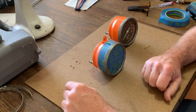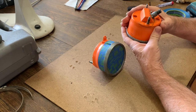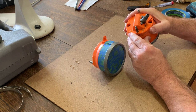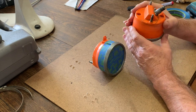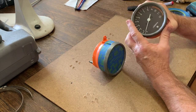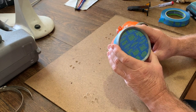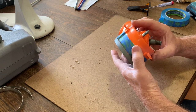Part of the restoration of the instruments is restoring these parts — the tacho and speedo. This one had a crack and the thread head stripped on this pin, so I bought a GS850 instrument set in kilometres. The original instruments on this bike were in miles since it's a US bike, so I've used parts from that set to fix cracks, changed the post, taken it apart and given it a clean. I've also adjusted the odometer on the speedo to roughly match what the mileage was on the original.